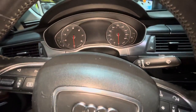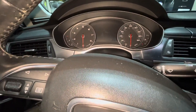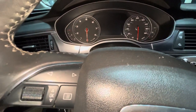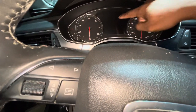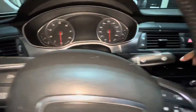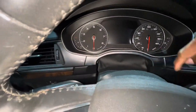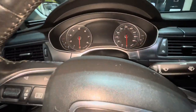We're getting ready to take out the speedometer, or the dash — some people might call it the instrument cluster — so we can install a mirror link screen behind it. We'll adjust the component to be able to mirror link this LCD screen with my phone. We're gonna be taking off these pieces, these pieces, and this piece so we can get to the screws behind here in order to pull the dash out.